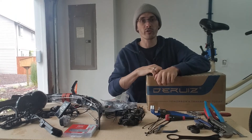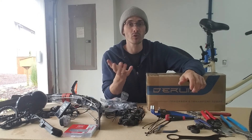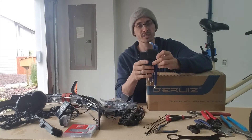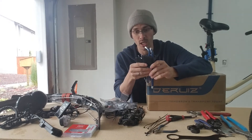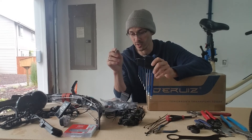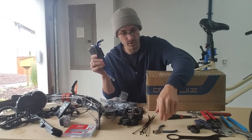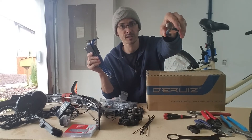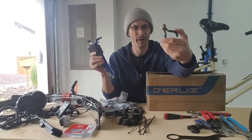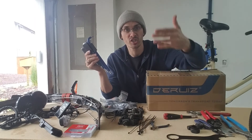Let's go over some of the tools you might need. This is by no means an extensive list — I have another video on this channel that covers tools in depth. You will need a set of Allen keys: 4, 5, 6, and 8 millimeter for your pedals or crank arms, as well as some smaller ones for the mini nuts and bolts that come with the kit. You'll need about a million zip ties of all different sizes and widths — this is only a small fraction. And something to cut the zip ties with: a nice pair of flush-cut pliers rather than scissors, so you don't leave a sharp nub.